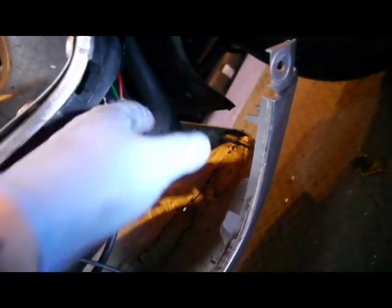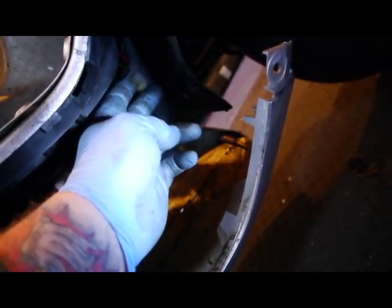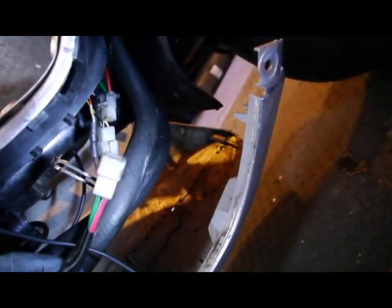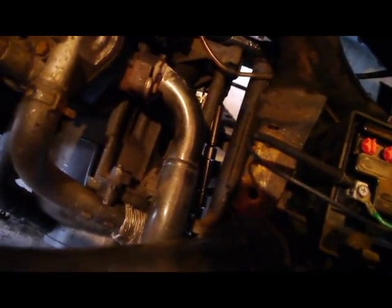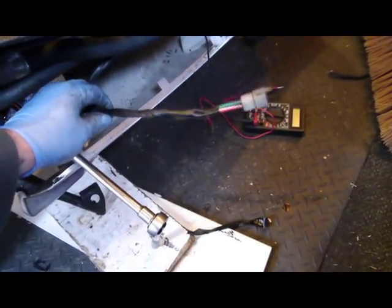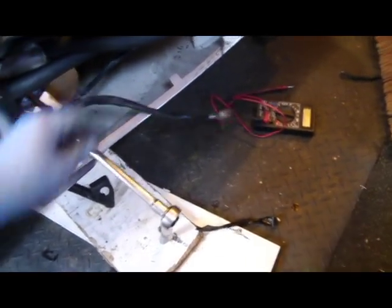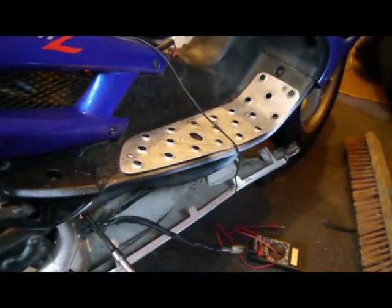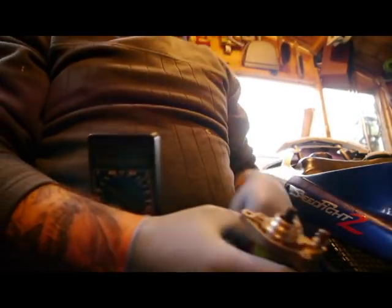It's going to have to come off - check the wires, belly pan off, and I'm going to check what's happened. So what have I got so far? I've got power coming from the starter to here - this is permanent live by the way. That then plugs into this wire here - red and white goes from red to red and white. This lead goes all the way down here. I've often said about using a long bar to get in there. I've got no power to the starter motor and this lead sounds like something's wrong - possibly a burnout.